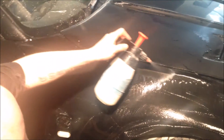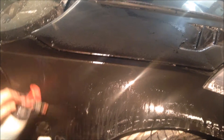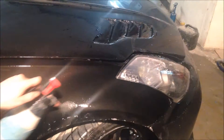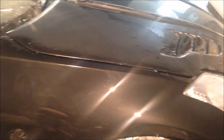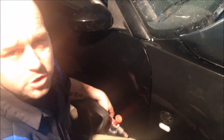Keep everything clean. Rinse it all off — if you rinse it all off, you don't have to then try and wash it down when you're going to compound. I've just got that front bumper to do. Look how nice that is — lovely. So I'll get on and quickly 3000 that front bumper. Then we'll grab the compound and show you where we're going to go compound-wise — how to start it, what pads are for what. Then you can go ahead, jump on the spray direct, buy the quartz compound and know exactly what you're getting.